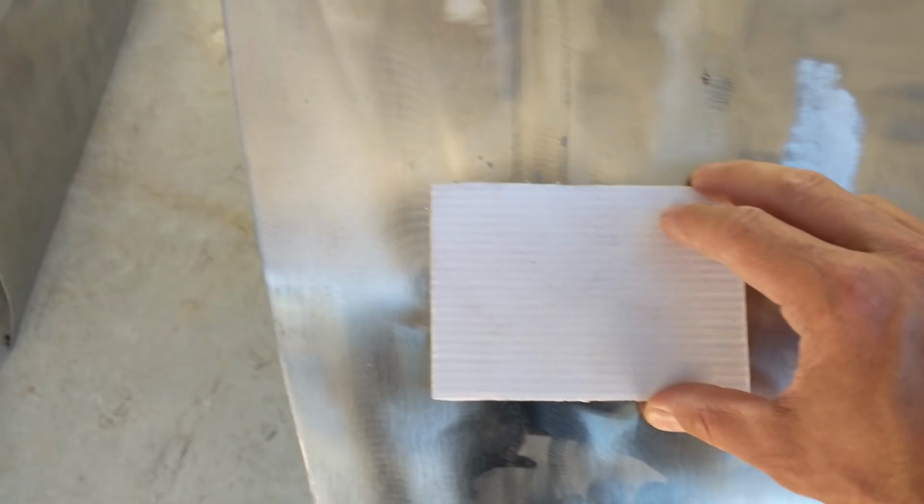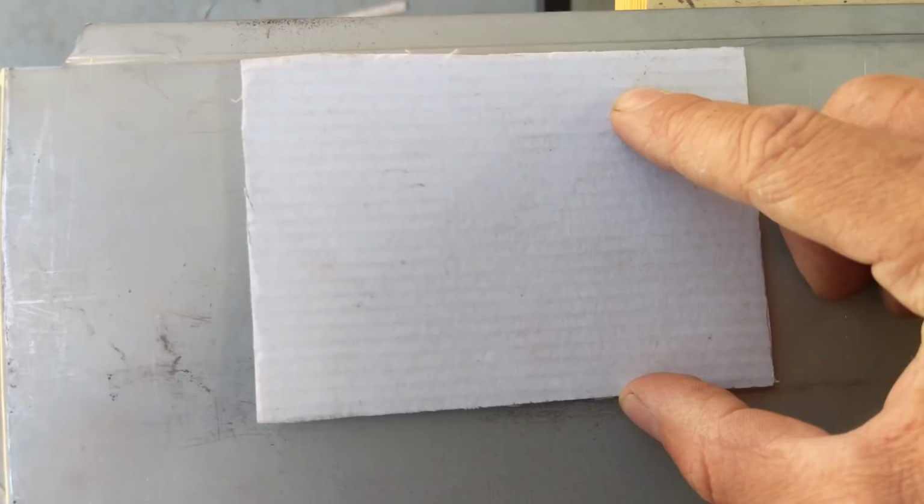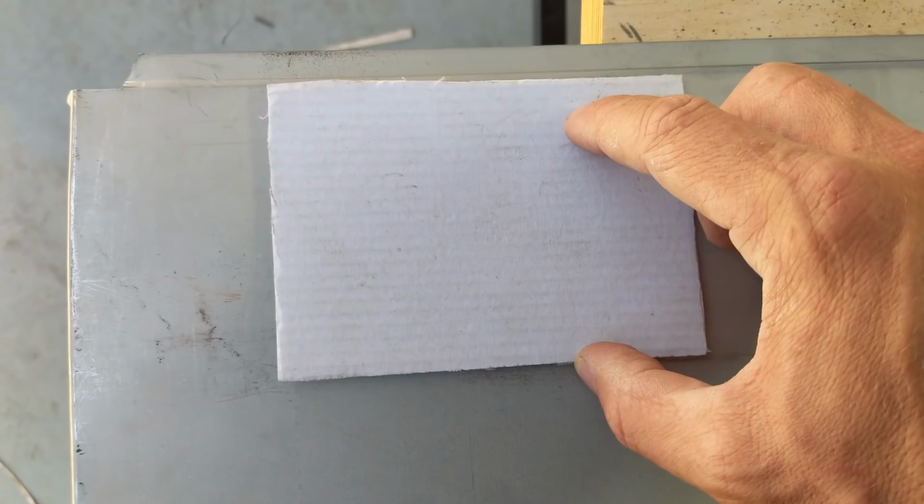And these panels look like they're reasonably well done. So what I've done is I've just marked out cardboard according to the size of the area that needs repair. And what I'll do is, now that I've got that rough guide, I'll transfer that over, and I know that the lip of that goes to the top lip of that, and that's going to have more than enough meat to cover that whole repair, and I get the profile for free. So yeah, that's going to be great.